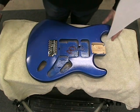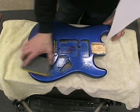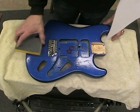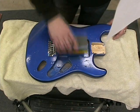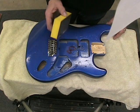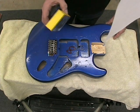With wet sanding, I don't apply any downward pressure. I just let the water itself provide the suction. I only sand back and forth in one direction — don't use a criss-cross motion and don't use a circular motion. I'm going to start with the 1000 grit paper — actually, this is the sanding sponge with the 1000 grit.